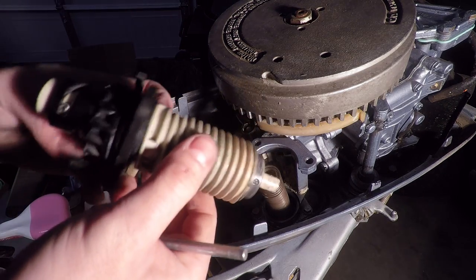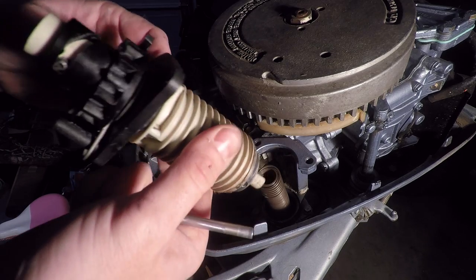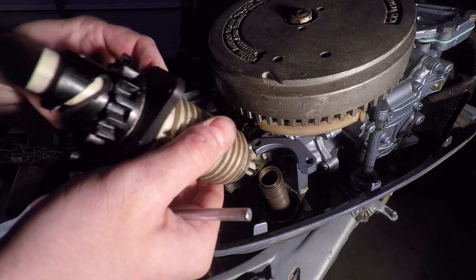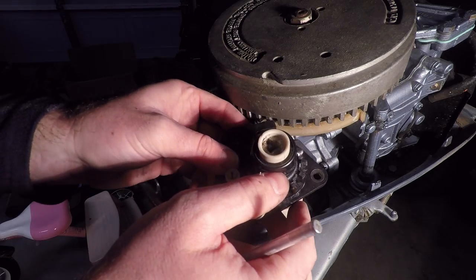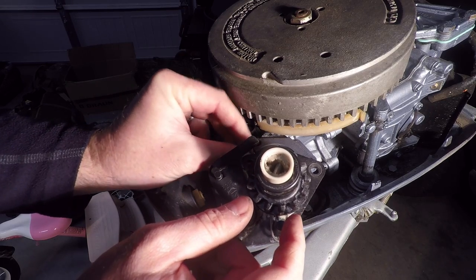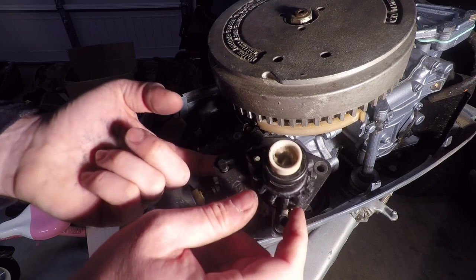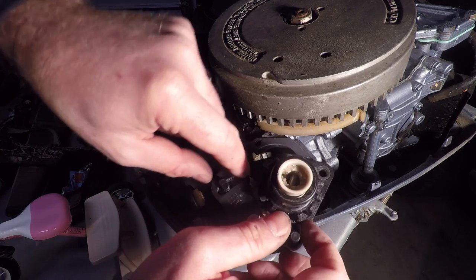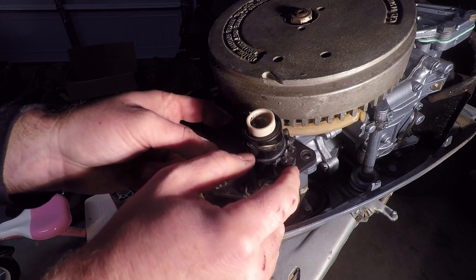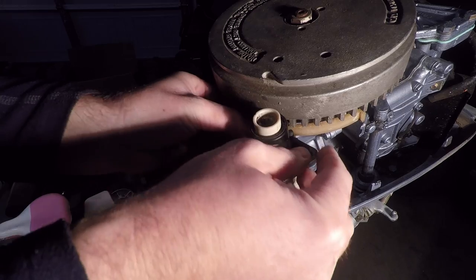Now we're ready to reinstall the starter assembly. Note we don't have the rope on here. You'll want to lubricate this end and also rotate the assembly so that it roughly aligns this slot with the slot orientation inside the spring. Once you have everything pretty much lined up, you can slide this end in. Don't want to forget your rope dowel — it's going to slide into a hole down there next to the forward retaining screw on the bushing, and it's going to fit into a slot on the bottom side of the plastic bracket right next to the forward screw. You can stick your finger up under there and feel it. Get it roughly in place, slide it down into position, get the spring set, and get that dowel pin set in its slot as well.